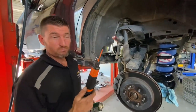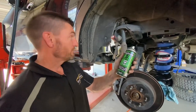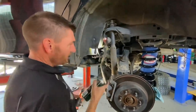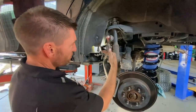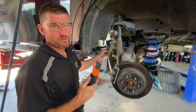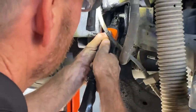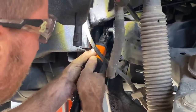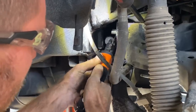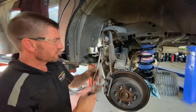Use a little air saw - it works brilliantly going through a high-tensile bolt. Use a bit of spray to make the cutter last a bit longer. With the bolt locked up, there's force on it stopping it from spinning. The head of the bolt is taken off now. Take that back out to unlock it.